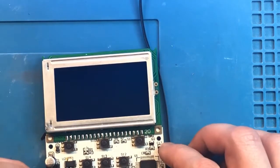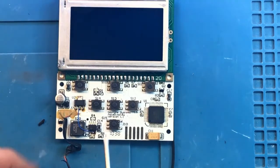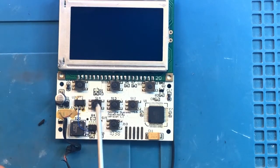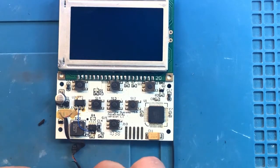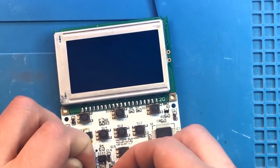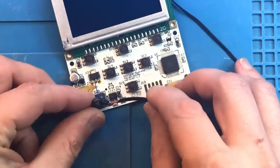This is what we have on the front panel. Neptune seems to love the idea of running jumper wires from one chip to another — it's consistent. I've seen it on EB-8s, EB-832s, displays. This cable is also frequently chewed up.